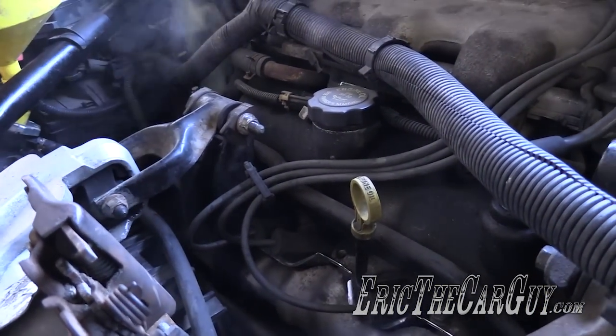But we did manage to repair this exhaust leak, which was what we were going to cover in this video. That was certainly a challenge and then some. Admittedly, part of it was brought about by myself because of my angles of drilling and dull drill bits — I ended up going to Harbor Freight and buying packages of new sharp drill bits. I used my drill doctor to start with but was having some real issues. The top stud removal went a lot better than the lower stud removal — didn't drill into a coolant passage, drilled it dead center, got it out, tapped it out, we're good. But that bottom one — yes, drilled into the coolant passage. However, I believe it was a win in the fact that I do not see any leaks on the cylinder head in that area. I think the JB Weld did the trick. Albeit we had to do a few modifications to get that repair to work, but the exhaust isn't leaking at the engine at the moment, so that's great. There's still some work to do, but for this video we're closing this out.